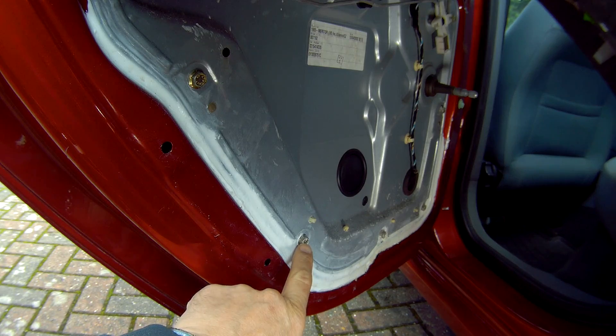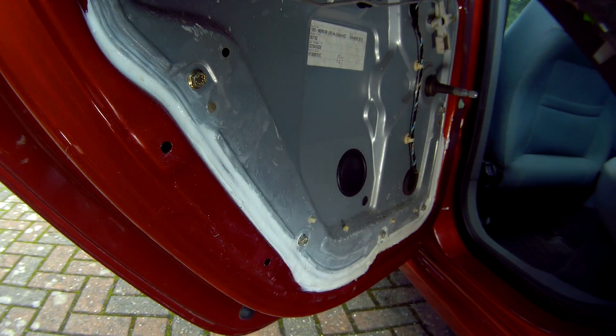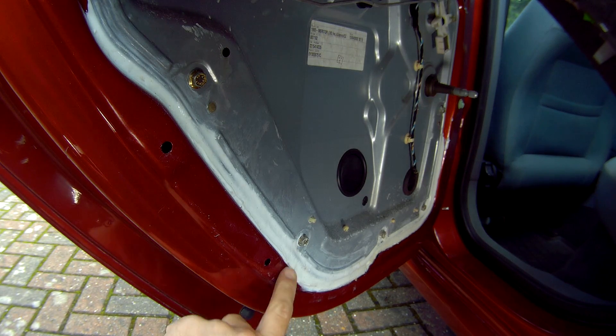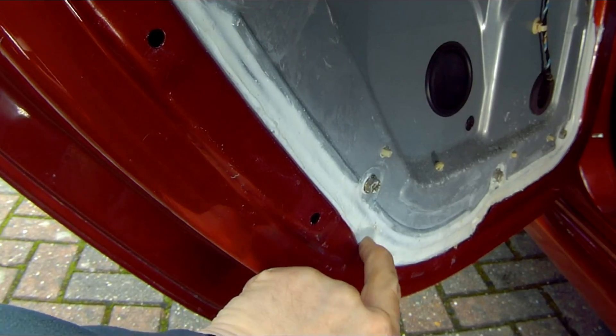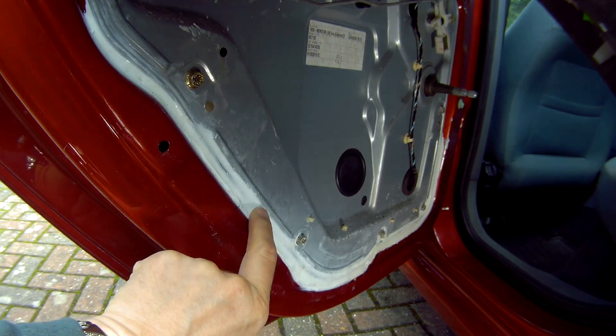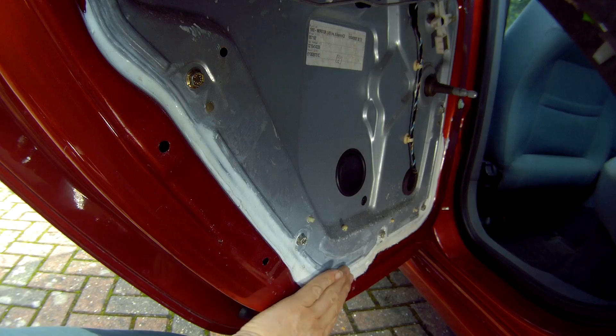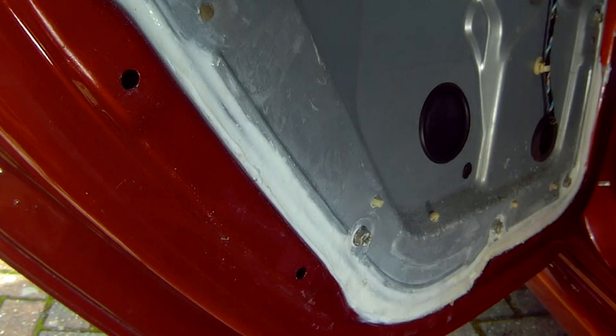Now you can see that I've done this previously on this car — in fact about 7 years ago — so I know that it works. What I did was take out the 10mm bolts that hold the metal panel and lift it away just enough to remove the bottom part of the foam seal, which was absolutely drenched and deteriorated to the point where it wasn't doing any sealing at all. I dried it out thoroughly and replaced it with a silicone seal, injecting it between the panel and the door, then loosely put the panel back just enough to tighten the silicone down after it had cured, making a good seal. What you can see here is a second bead of silicone that I put over the first to cover the whole joint, and the job's been a good one ever since.